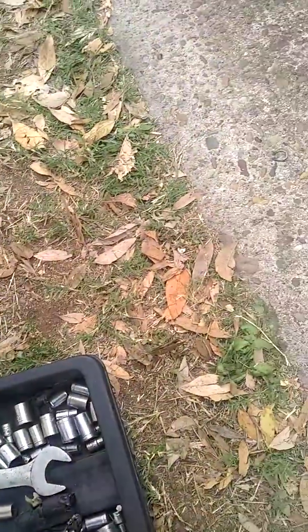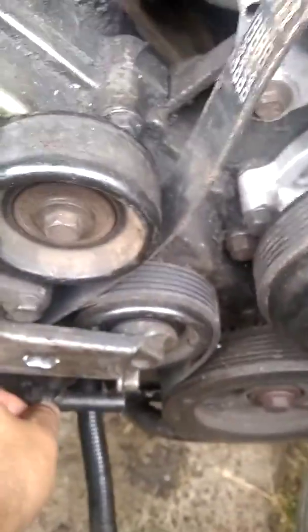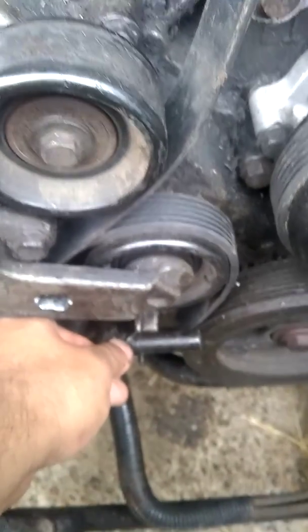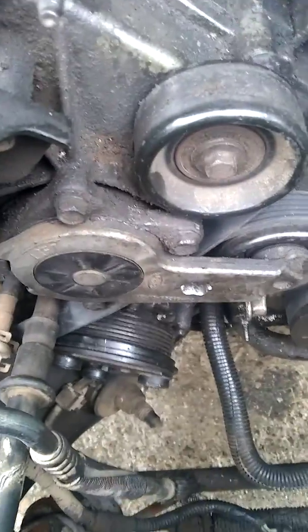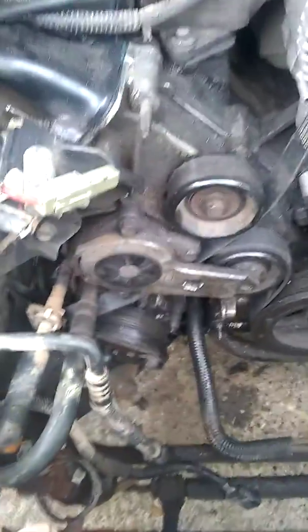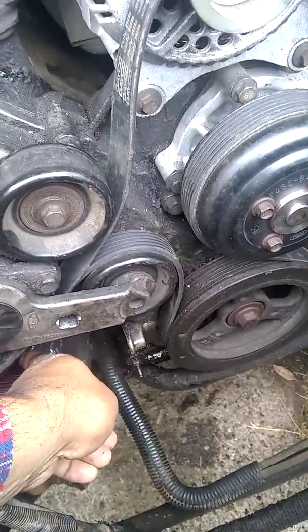It's about the size of the handle of a screwdriver. This sensor sits in the motor like this and it's real long. I was having a hard time myself until I called a buddy of mine to help me. Don't take the pulley off the AC compressor — you have to take the whole compressor off itself, move it down at an angle, and then wiggle it out this way.